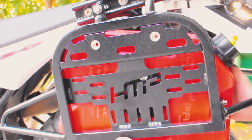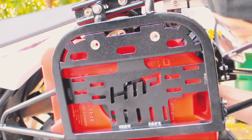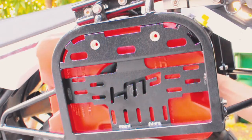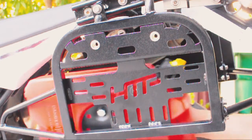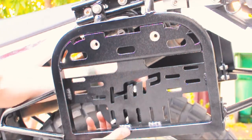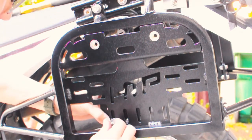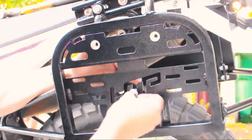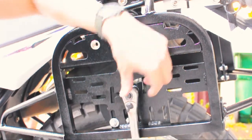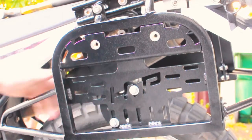You'll have to determine how the Rotopax is actually going to fit onto the mount and what mounting locations you're going to use on the inner rack. I did this by installing the Rotopax onto the locking mount and just seeing where the holes would line up. Unfortunately with the SU side racks, there isn't a spot where the Rotopax mount will match up perfectly where you can use all four mounting holes. Of course you can drill your rack, but I didn't want to do that, so I found the two spots that would work and have just been using those.